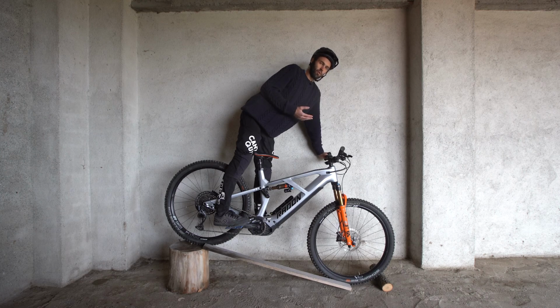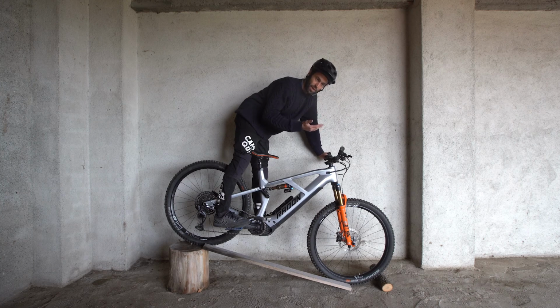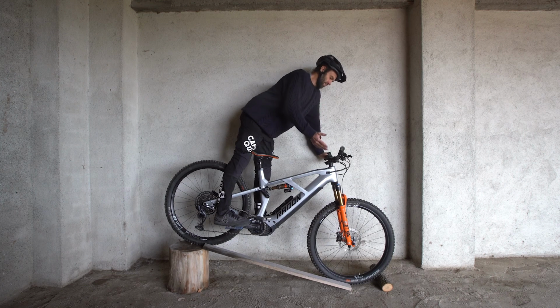very little support, and we know the Grip 2 damper has got quite a low level of compression damping compared to previous dampers, and I believe, and again I can't prove this and there's no information about it, the Fit 4 damper has less damping than the Grip 2, and the e-bike tune of the Fit 4 has even less damping force than the normal Fit 4, which has less than the Grip 2, which has less than all the previous Fox forks. There's also millions of combinations of this fork, from the leg length, the travel, the damper type, the air spring length, lots of different things.